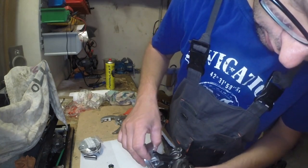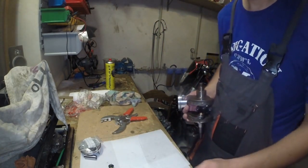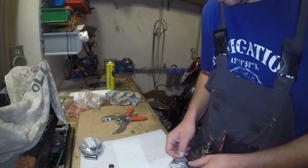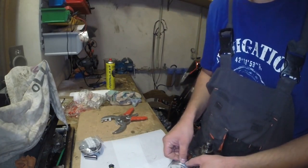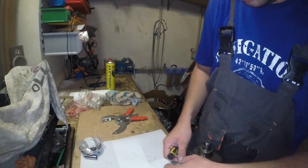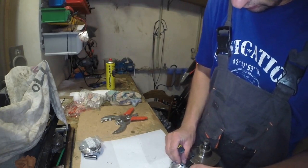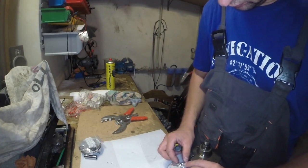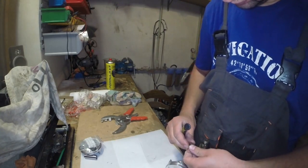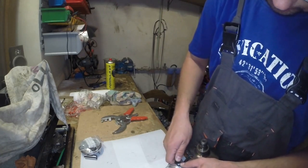And once the piston is in place, the wrist pin is in place, we need to lock the other side with wire. It is tricky because this crank is not very comfortable to work on, but it is something to be done after a few tries. As you can see, I'm using the second side of a small screwdriver with a plastic end. It's just better to use something plastic instead of your fingers, because this is a hard and sharp object. You can just easily cut your fingers.